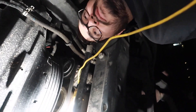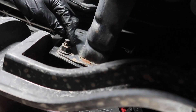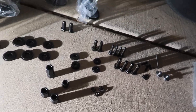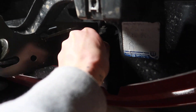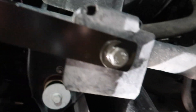Alright Warren, what are the first steps? So if you don't have the tow hooks, you need to do this first step — remove these nuts, these bottom ones, then install the bracket on both sides. We have all the accommodating brackets, washers, spacers, nuts — the whole nine yards. Just got one of the brackets on, pretty easy. We utilize the OEM mounting hardware. Next we'll be putting on this piece here to bolt up — brackets on brackets. We got another additional bracket on, utilizing this J-piece and the stock tow hook mounting hole.